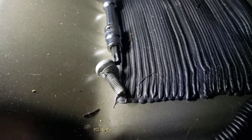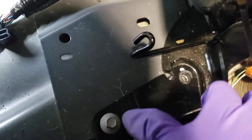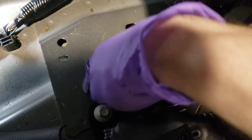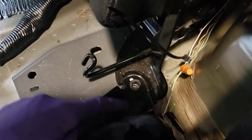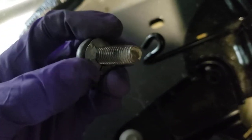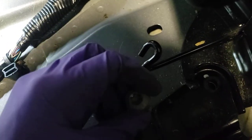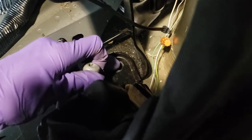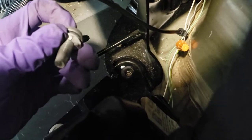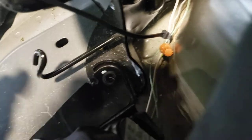What I noticed is this one I got used didn't have the bolt. This bolt here was already installed into the vehicle from the factory, but this bolt on the old seatbelt — the new one did not come with it. So I had to reuse it: take the bolt off the old seatbelt, bend the little prongs outward so I could slide it out, then move it to this one. You want this little lock washer on the bottom, then put the bolt onto it.